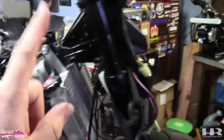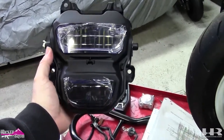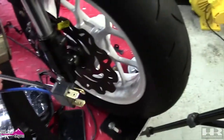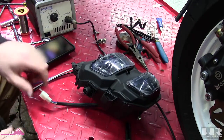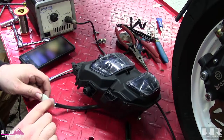The next thing we're going to do is the headlight. I have another new item I purchased — since this is an SF, this is a 12-volt SF clone headlight. People say it actually does better than the factory SF headlight, so we'll give it a go. It's got a 3-wire plug on the back — we can slice that off. I purchased an H4 pigtail, the male one, since the bike's harness uses a female version, so we're going to make this plug and play.